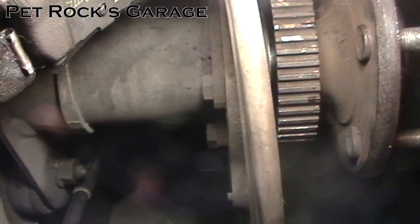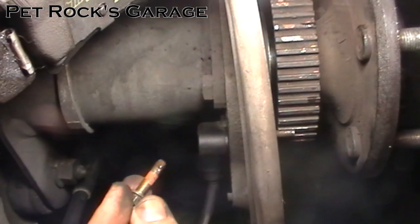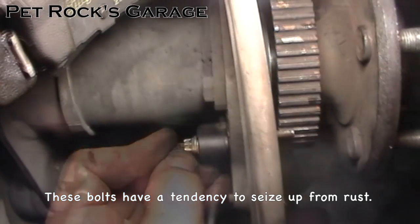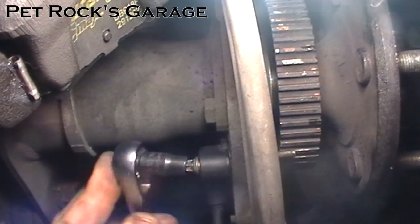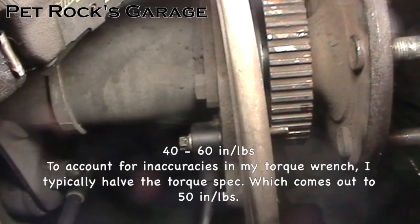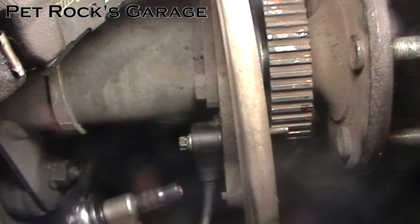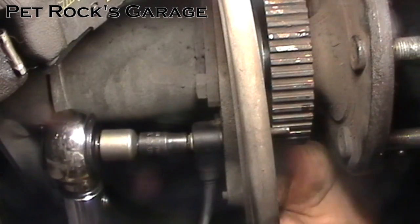Back over to the axle and reinstall your ABS sensor, sliding it into place. Put a little dab of anti-seize on the end of the bolt to make it easier to remove later if you ever have to. Then take your E8 Torx head socket and snug it down. Once you get it down about finger tight, take your torque wrench and torque it down between 40 and 60 inch-pounds. These bolts are known for snapping — that's usually from people over-tightening. Use a torque wrench whenever possible.